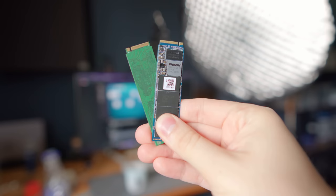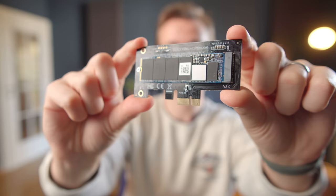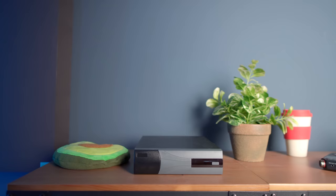Storage is where this gets a little weird. Normally you'd want to use at least two hard drives in RAID 1 or something, but I had two 1TB NVMe drives laying around that I don't really have any use for. So I used one of them as the storage drive, coupled with a PCIe X1 to NVMe adapter. Yes, that's going to bottleneck the drive quite a lot, but I think Wi-Fi is probably going to be the ultimate bottleneck anyway. For the case, I'm using this no-name Minitex case that I got off eBay for 21 Euros.